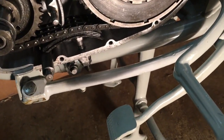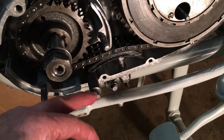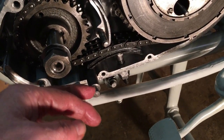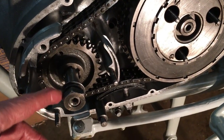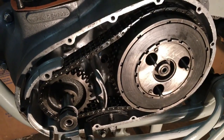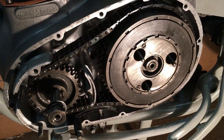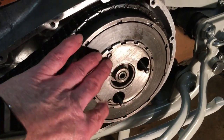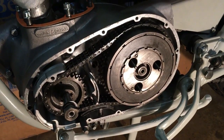And also we've got the slipper tensioner on, we've got its spacer here, and then the remaining part of that spindle as a stub goes into the outer case once that's on. We've just got the requisite washers and the nut on this side, in preparation for when we do the alternator and the rotor, which will be the next video. This just needs tightening up to the proper tension, and then we can put the plate on here with the push rod in the centre. But anyway, that's the primary drive on.